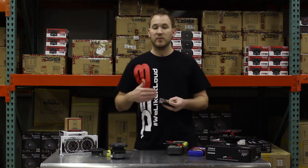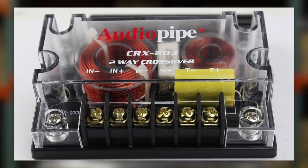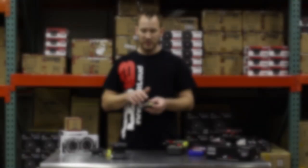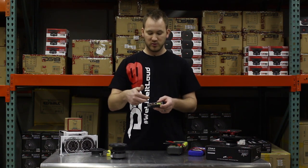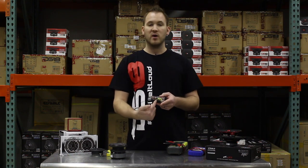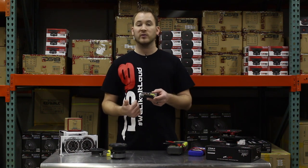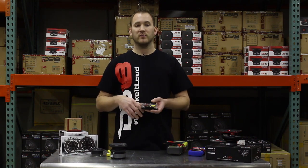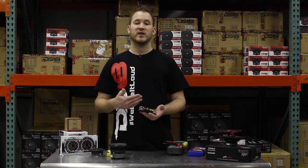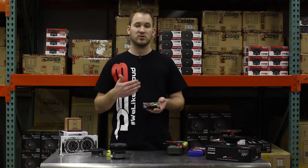If you really want to upgrade your system, they sell crossovers like this one made by AudioPipe — it's called the CRX203. This is a basic two-channel crossover. The speaker input goes into the first two labeled terminals, and then you have two output terminals: one for a woofer or mid-range speaker, and the other for the tweeter. This is going to filter frequencies better than a capacitor-style filter. These are typically under $20, so it's a really good investment, especially if you want your system to sound balanced and make sure you're getting the correct frequencies to each component.